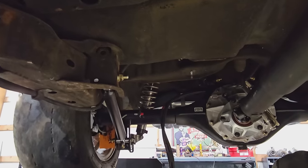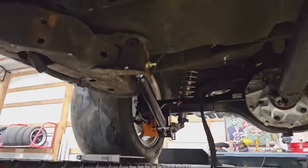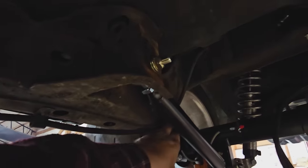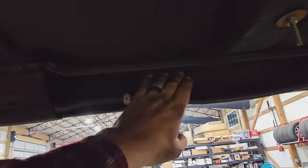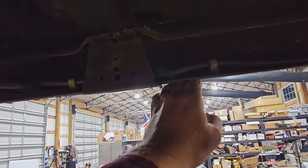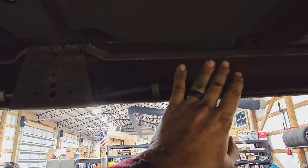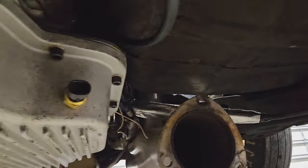We're going to go up and over that so we stay out of the way of the cool exhaust Chad's going to run. And then we'll come probably down, follow this battery cable. And then I like to go inside the frame rail like this to protect it. So when you're bottoming out and stuff like that, you're not hitting your fuel lines. And then also we can hide. I got to put a filter in here as well. And then we'll run up like we've been talking and go probably right up through here and catch that regulator.